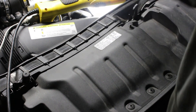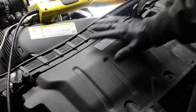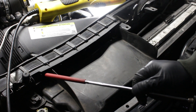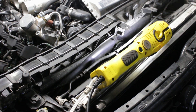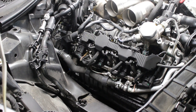To get us extra room for removing the air box, we're going to pop up these tabs on the vanity cover and move that out of the way. That will expose the T20 screws located here and here — we'll pull those out, and that should help us get our air box out of the way. Now we've given ourselves a lot of breathing room to get in there and reach that fuel line.